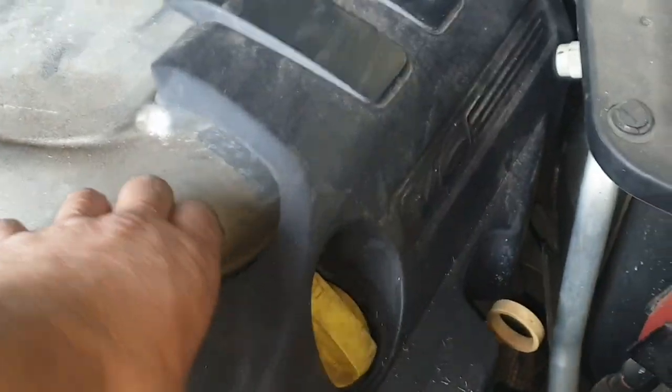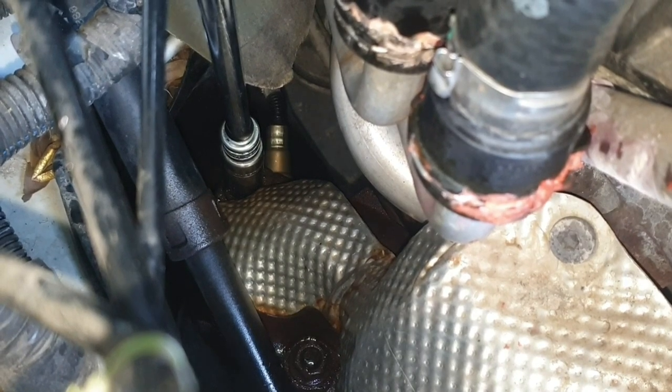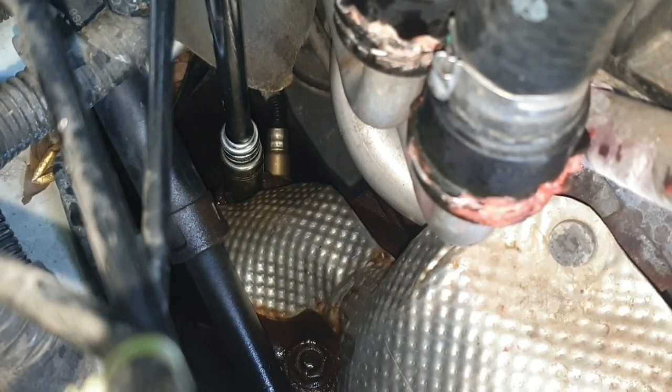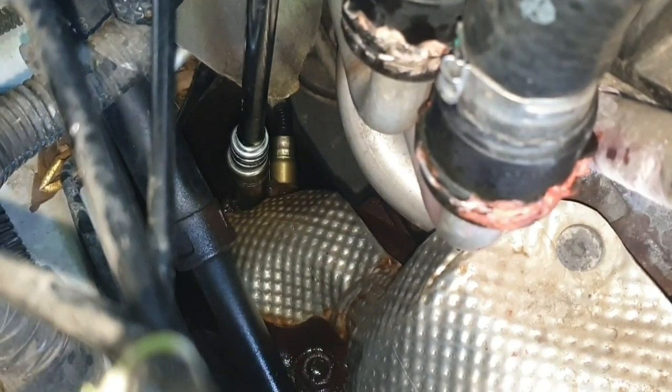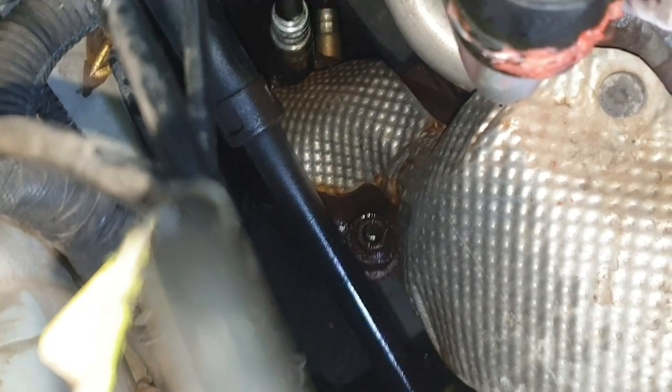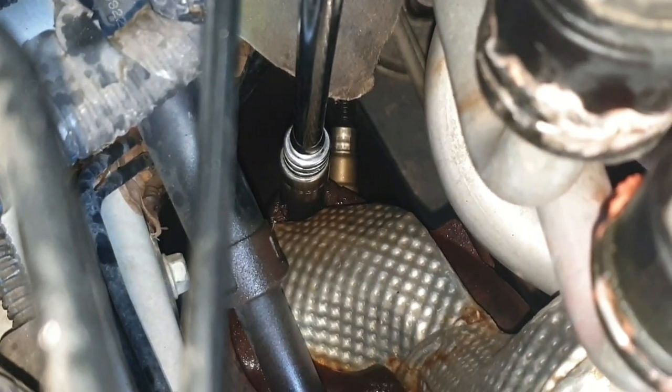Remove this plastic cover which just pops off. I can only get to one nut down there, so I have to get that one from below. These bolts will be very stiff or seized — I got it to crack with a fair bit of effort, but once you get it to crack just work it back and forth trying to get that CRC through the thread. I've used a single hex 15mm socket with a couple of extension bars and a half-inch breaker bar just to crack it, then gone back to a 3/8 drive.